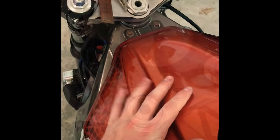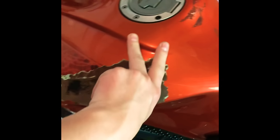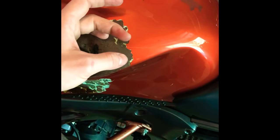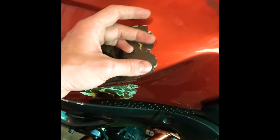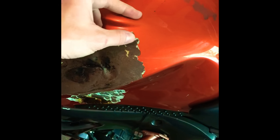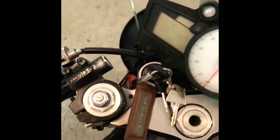The way you go about doing this is very simple, but you do have to do a couple of things first. You have to take your seat off — it's two allen bolts. You have to fold your tank back using the same allen bolts. Move it back and disconnect the green fuel pump connector — the electronic connection on the underside of the tank. Then slide your tank back down and you're done with that.